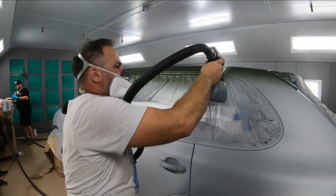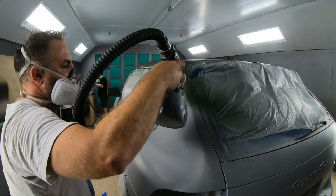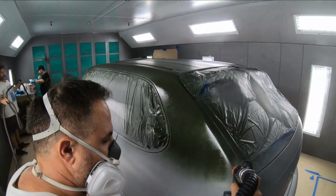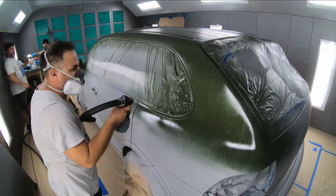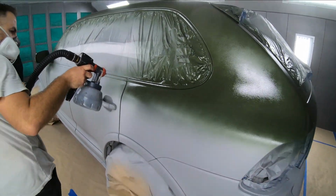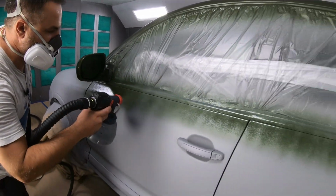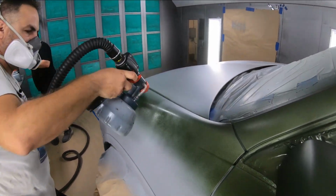And what you also want to make sure and keep in mind is you're spraying that same coating into those hard to reach areas like your bumper covers and areas that might not be as accessible, because those areas have to peel as well. You can see as we're working it from the quarter panel, you're going to keep it all the way and walk the whole entire car all the way to the fender. This can be a problem sometimes with the mirror, but you work around it.